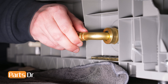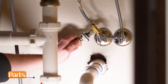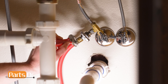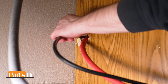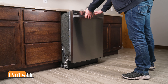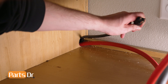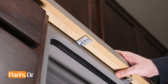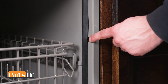To reinstall, begin by installing the water inlet line to the back of the dishwasher. Or if you had to disconnect the water inlet line from the house's plumbing, feed the water line through the bottom hole in the cabinet and reconnect it to the plumbing. With the dishwasher near the cabinet, feed the drain hose through the holes located towards the top of the cabinet and feed the power cord through the lower hole. Now push the dishwasher back a few inches underneath the countertop and continue feeding the drain hose and power cord through the cabinet. Repeat until the dishwasher's in place. With the dishwasher's door open, align the holes in the mounting brackets with the pre-existing screw holes on the underside of the countertop or the screw holes in the cabinet if using the side mounting option.